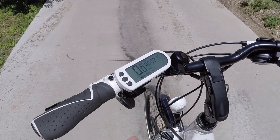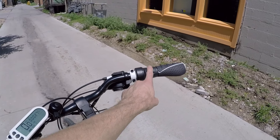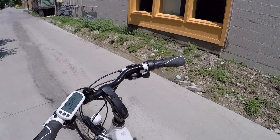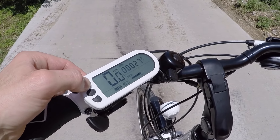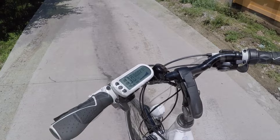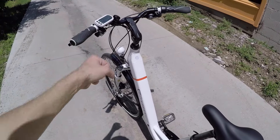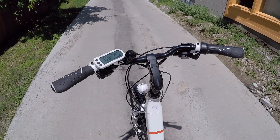The real info you tend to use is down at the assist level. In zero, you can use the twist throttle at any time — just twist and the bike takes off, super simple, though it uses a bit more energy. When you do pedal assist, arrow up gives you 30% assist, then 50%, 70%, and 100%. There are four levels: the higher you go, the more power the motor and battery exert, but the quicker you run it down. This is a torque-sensing system, so you'll have to actively push a little more than with some cadence-sensing bikes.